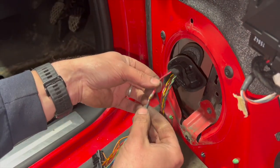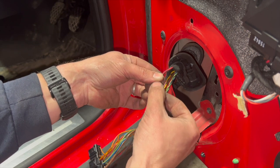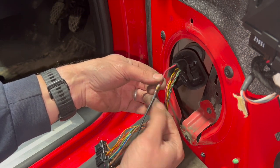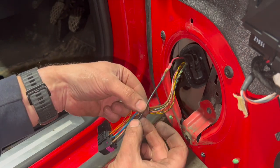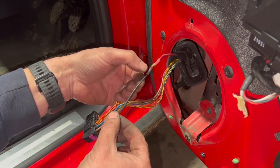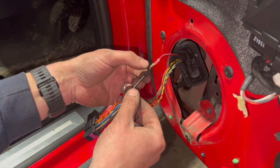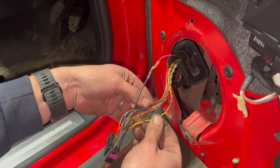Yeah, so that's the first solder joint done. Once it starts to go, you just see the solder run. It runs either way down it, and then obviously the two red pieces seal it up. So that's nicely sealed there. Now I would sometimes put a bit of heat shrink over, slide that over, and then shrink that on as well. We've actually run out of the bigger heat shrink, but I've got some for the smaller wires. So once I've done the bigger one, we'll use a little bit on there.